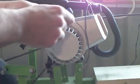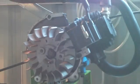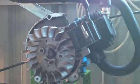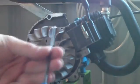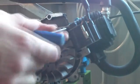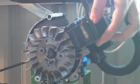So we're going to take this cover off here and show you how to do that. Okay, so now that the cover is off, we've gone over the parts and everything. We're going to take our T-handled Allen key — this is a 4mm — and what we're going to do is just loosen those up, just like a quarter of a turn. See that? See how it just dropped? And there's just a tiny bit of play in there.